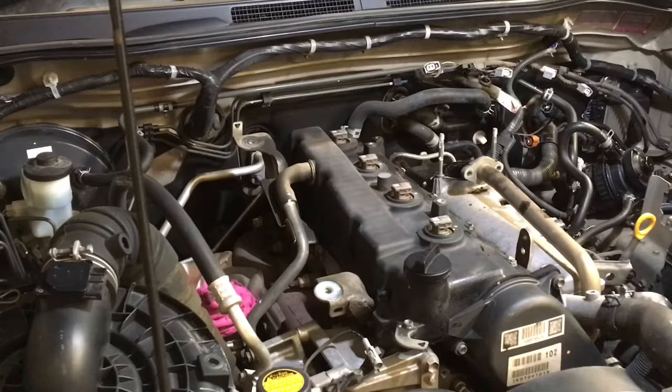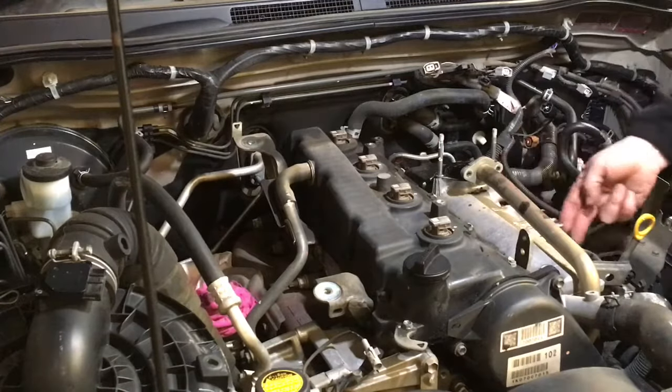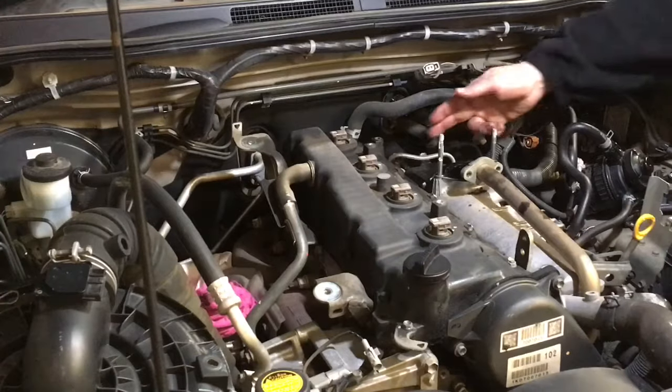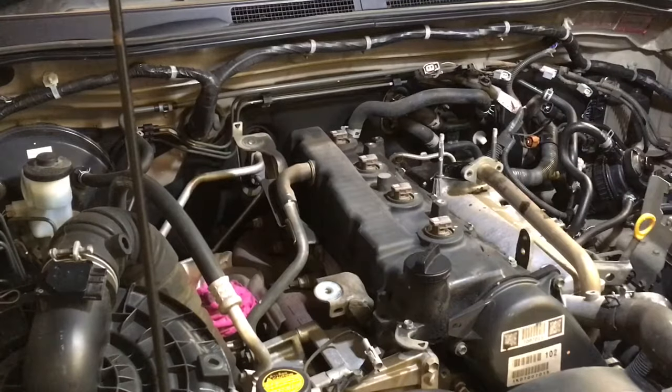While we're at it, I just thought I'd mention, if you're going to take your manifold off, you're going to take this fuel return line off, right? It runs down under here. When I talk about the return line gasket, there's a little double-sided washer gasket that goes there. We supply that. If we say inlet manifold and the gasket, that's what I'm talking about, that gasket there.